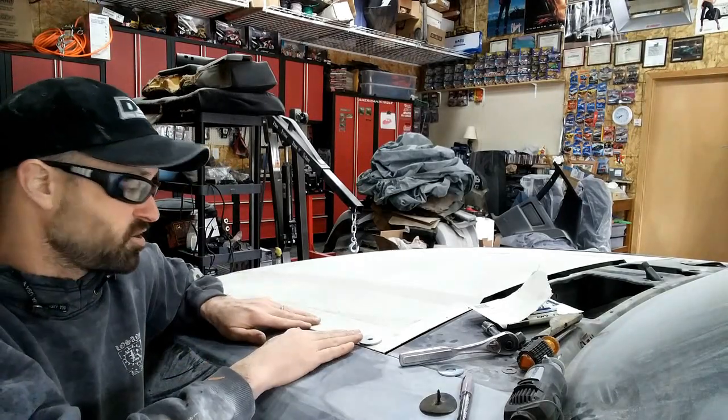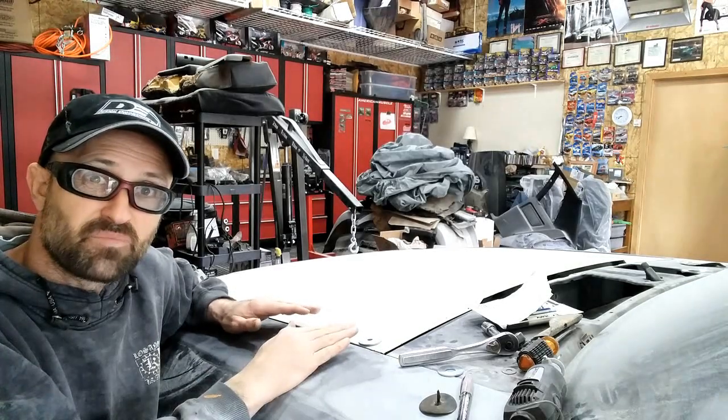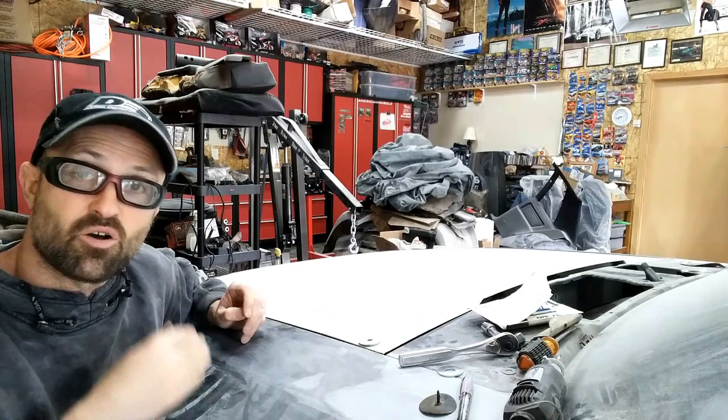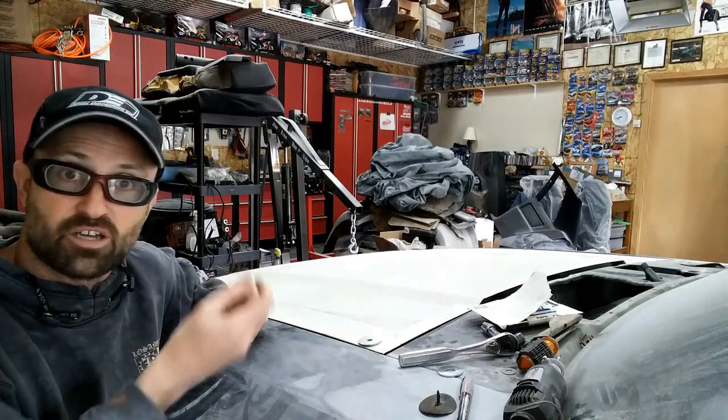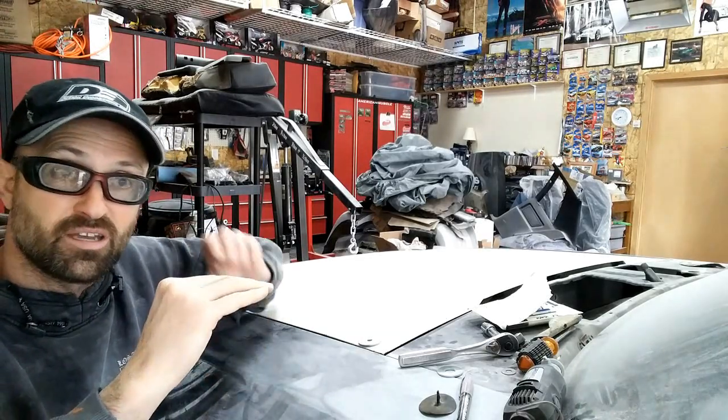Now it's just because the hood was already kind of balanced, not, I guess, equally balanced. But in order to put those in, do one bolt at a time. So I did the first bolt, I took it out, I then used a screwdriver just to kind of pull the hood hinge down away from the hood, slid the 2 washers in, put the bolt back.